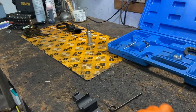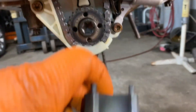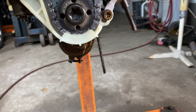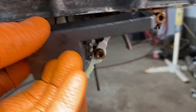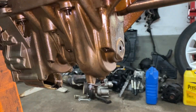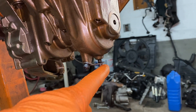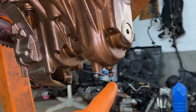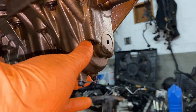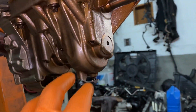So you're going to need this tool — it's also included in the kit. On the bottom, if you're going to change the oil pump, here's another tool that goes in here. These little things go in here, and you put two 10 millimeter screws in so you can take that bolt out. Then there's the oil pump housing over here — this is the counterbalance shafts. There's a pin that goes in there. You take out the filter and it's a little pin that goes in there with a little nut to keep the balancer in timing. When you turn it, you're going to see a little hole that this slips into at top dead center.